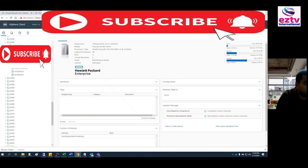I have an HP server, and I want to show you how you can apply the upgrade. First thing is the firmware update. I'm going to show you step by step. The host has to be put in maintenance mode. You have to power off the machines, or move them from one host to another, or you can power off the machines and put the host in maintenance mode. This is a standalone host, so I'm not able to move the machines from this host to another host.